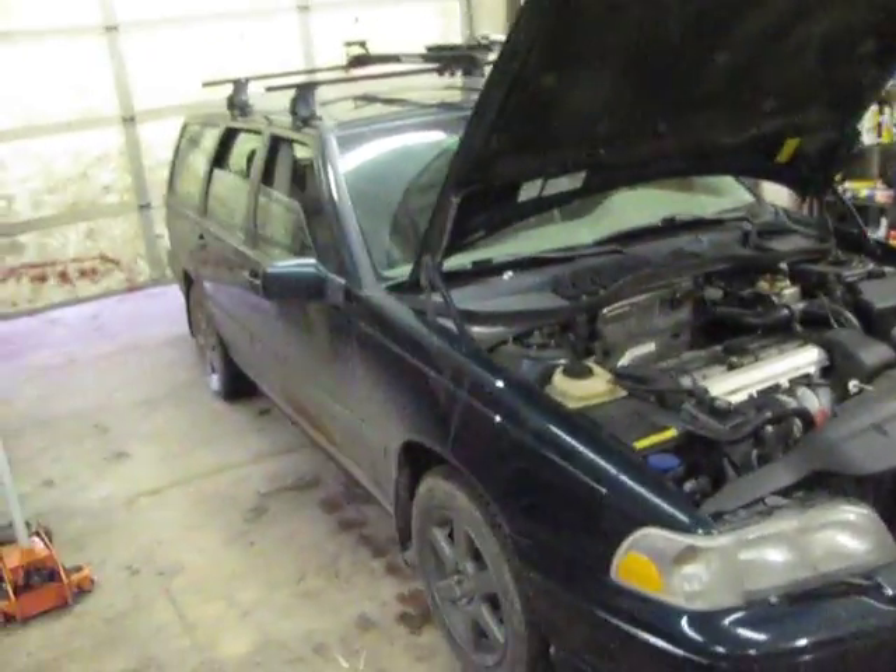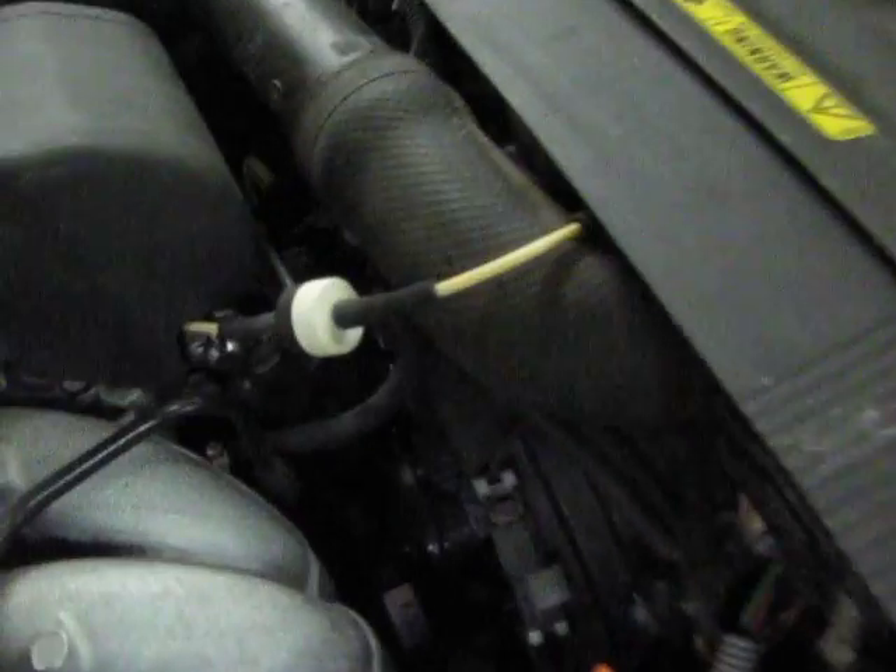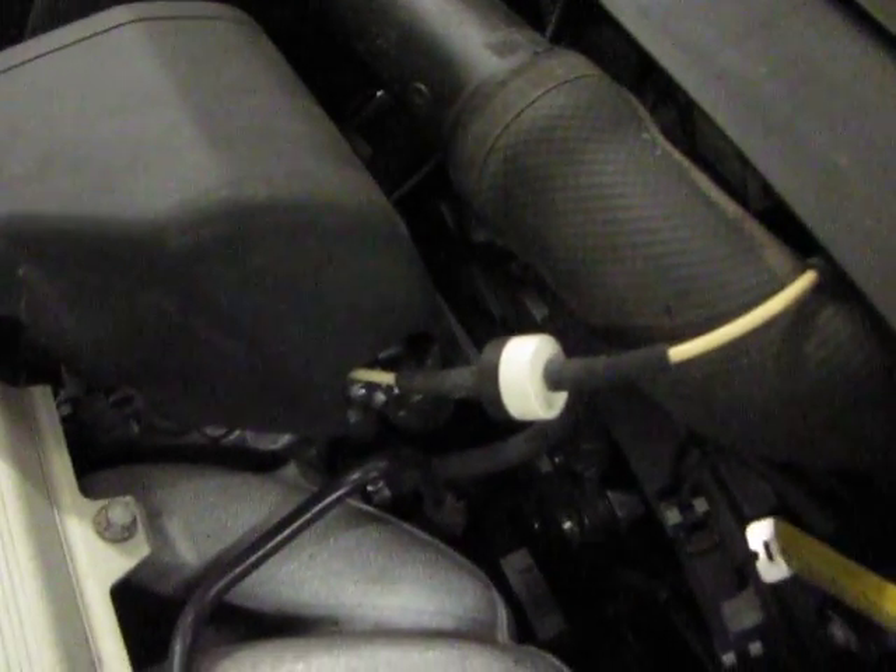After I went and bought it, I started looking at my own daily driver, which is this Volvo turbo wagon sleeper mommy car — that's a whole lot of fun. And lo and behold, it happens to have the exact same fan, and the bolts here make it equally as removable. It also has the same controller. So if you're not looking for the same shroud — in this case, this shroud on this radiator is fairly complex and quite thick — I wouldn't see a whole lot of advantage of using this versus a Ford Taurus fan unless you wanted to make your own shroud and just use the fan.